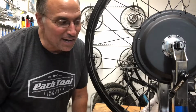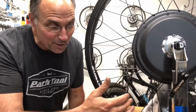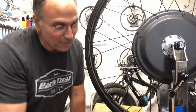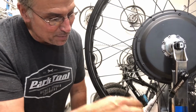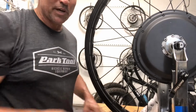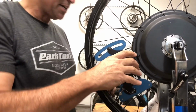In this video, I am continuing my balancing of the tension of the partner spokes on this side of the wheel that I'm in the process of truing. So I come up here to where the valve stem hole is. I'm working on this side, checking out the tension here.